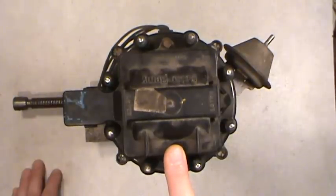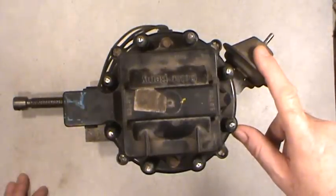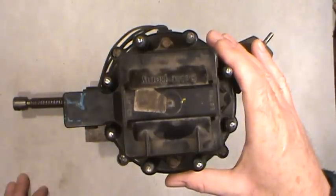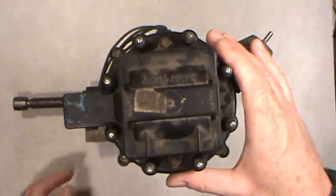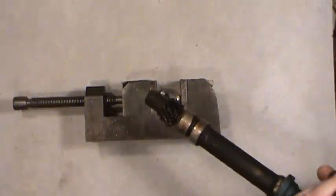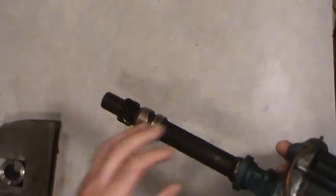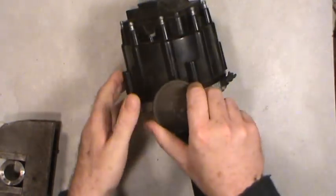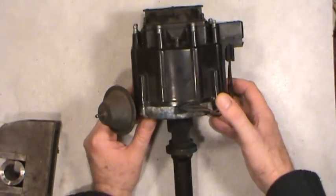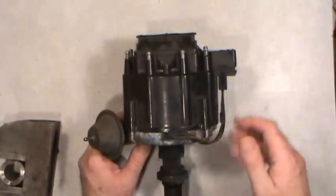This is my introductory video, Part 1 — basically an overview explaining what I'll be doing in the future videos of this series when time permits. From the top you can see the vacuum advance canister and the big distributor cap to contain all the high voltage these things are capable of putting out. I've got it in a drill press vise with a piece of heavy metal tubing with the drive gear extension on it. I'll also be showing you what to look out for when you take one of these out, and how to set the engine for top dead center on the compression stroke to make sure everything lines up when you put the distributor back in.